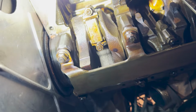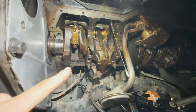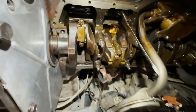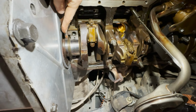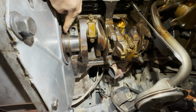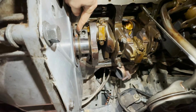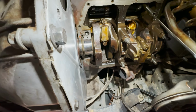Yeah, let me get this off of here and I'll show you what that rear main looks like. I popped off that girdle along the main caps and then came in and took out this rear bearing cap. I'd show you what's going on in here. And right up here is where that rear main seal is, it's a two-piece rear main seal. And there's a little bit of RTV up there from the mating surfaces. But crank looks to be in good shape on that bearing anyways.